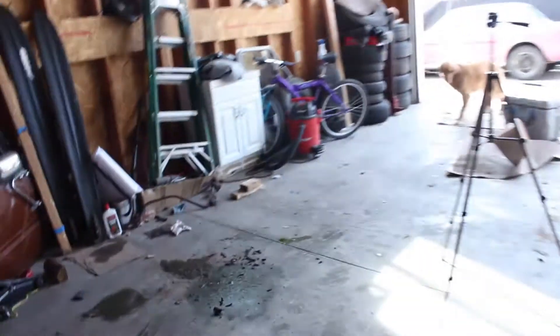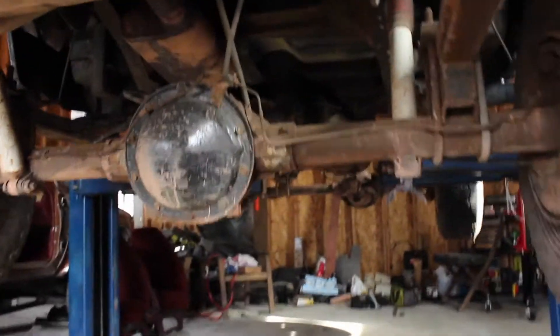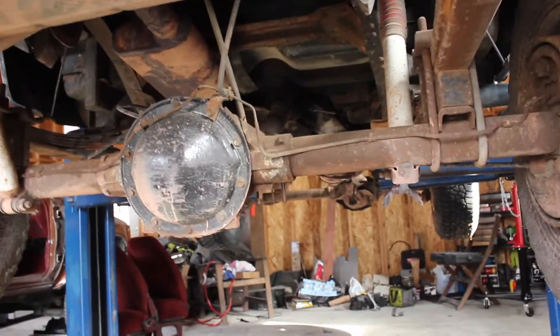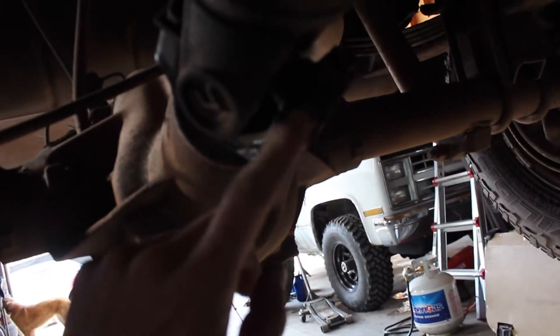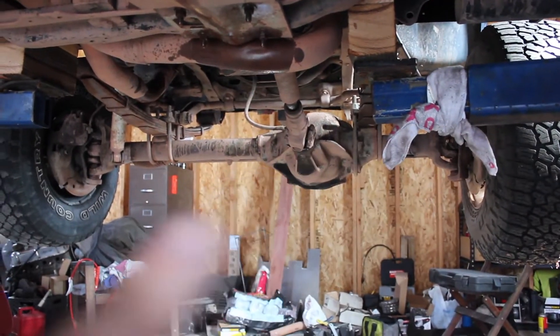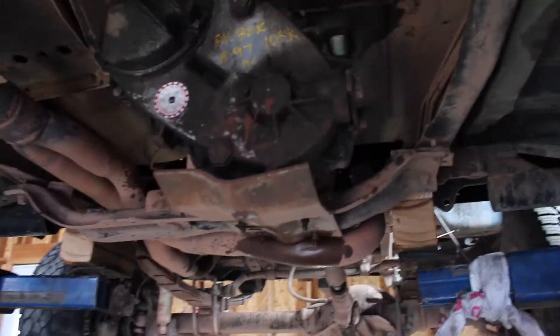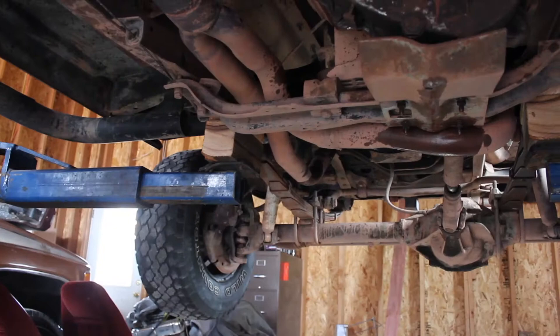I think that's just about everything I need for the swap - I'll let you guys know what I get into as I go. First step on a transmission swap is always the drive shafts - both front and rear drive shafts need to come out. They look like 10-millimeter bolts, four of them on the rear, and the same on the front. There are also some bolts that bolt up to the front of the transfer case yoke. I'll check back in once the drive shafts are out.